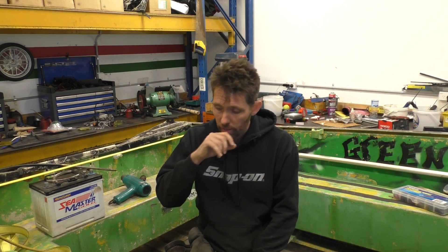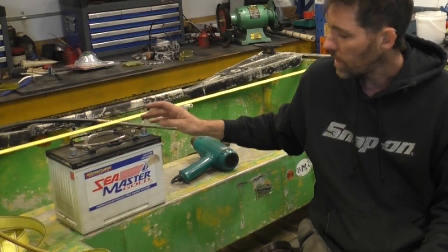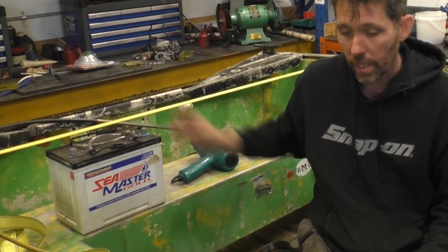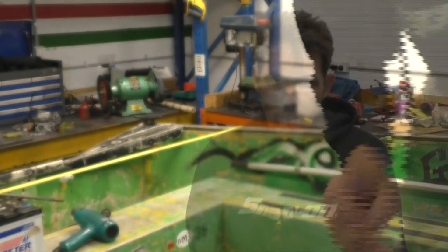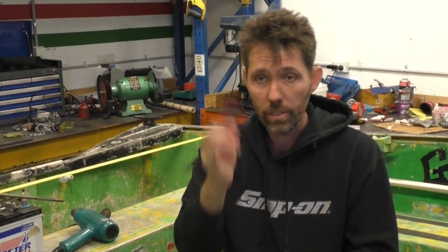The first thing I'm going to do is make up the wires that go to the battery. Down the track I'll probably put a battery switch in, so I'm going to make this with a fair bit of slack - maybe one loop near the battery just to give me scope for the switch wherever I position it. The battery has 8mm threaded posts, so I'm going to attach lugs with an 8mm hole over the post. These lugs have an open end that I'll be soldering into. I'm going to put a 20 amp fuse first thing after the positive terminal. This slightly different style fuse holder is a bit more UV protected, so this one goes outside and the other one goes under the dash.